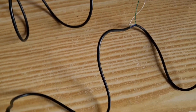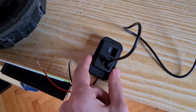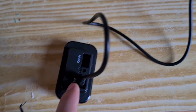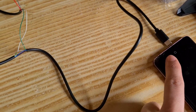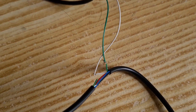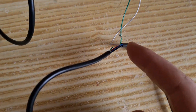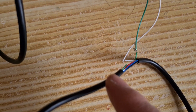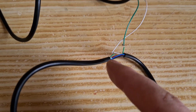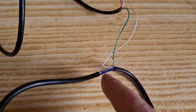So basically what the cable looks like: we have this power source that I bought from China from AliExpress. Then we connect it to the PD or the power delivery port - this is very important. The cable goes directly to the phone and it charges it quickly. And then for the Android Auto we have a separate Type-A connection here. The important part is we have connected the white and green wires, which is the data plus and minus, to the other cable. And the other cable - the part that goes to the power supply - has been stripped of its data cables.